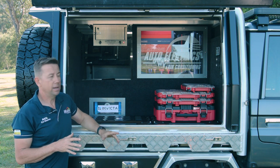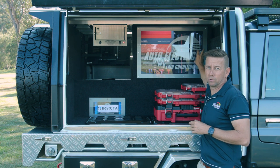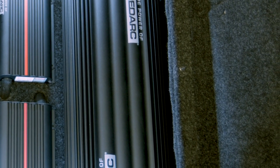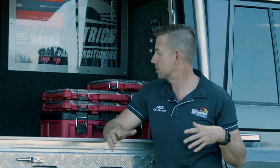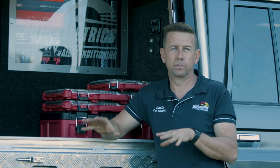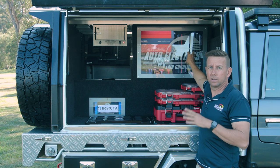The way we charge the battery is over here. To charge it we've actually got a couple of things going on. For basic everyday charging we're using the Redarc Manager 30. The Manager 30 handles my solar panel — I've got a 150 watt solar panel on the roof — and it also handles if you ever wanted to plug it into 240 like a caravan park. It also takes the alternator current and converts that to charge while you're driving, so that's 30 amps coming in from the solar and the alternator as standard.